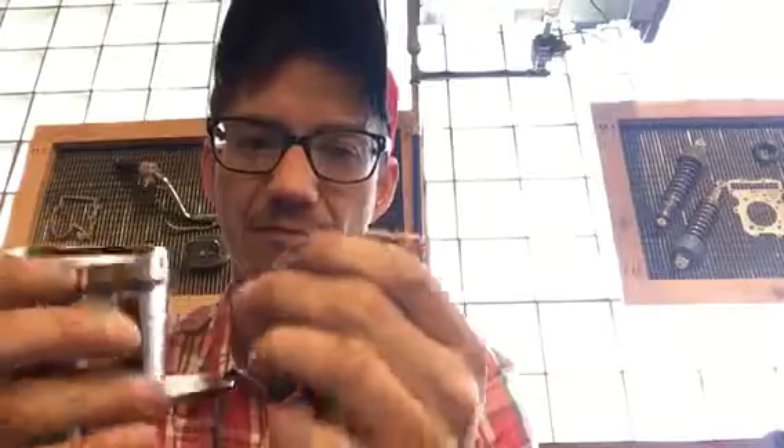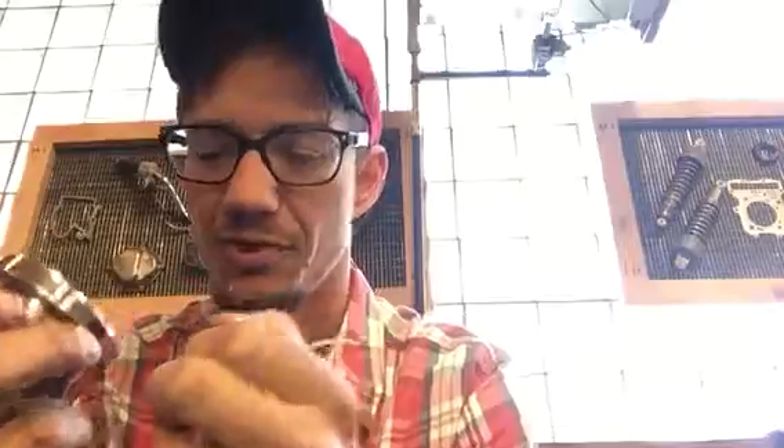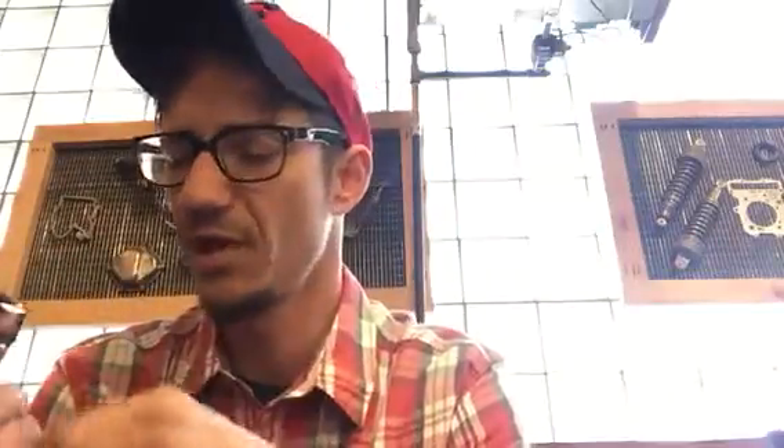So you don't necessarily have to look for another cable — you can actually convert to an electronic tachometer. You have your wires for the lights, power, and whatnot. This one also happens to have a fuel gauge which I'm going to wire up. What you do is find the wire that's your sensor and basically tie it right into your coils — not the black lines, because that's a constant current. Go to the blue or yellow wire — find your primary coil and tap right into that.